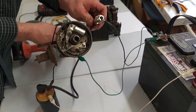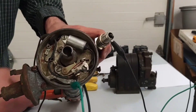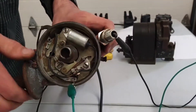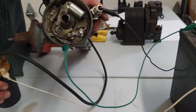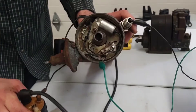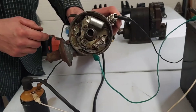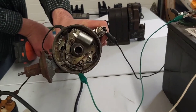Our spark plug is usually grounded in the engine block as well, so I have a ground wire connected to that. You'll notice that the spark plug is connected to this black wire which comes out of the middle of our ignition coil — that's our secondary circuit. So all these small wires are primary wires because they're low voltage, and this one big wire is our secondary wire because it's high voltage.